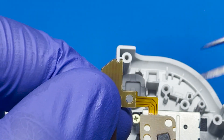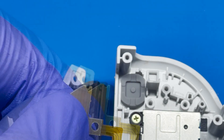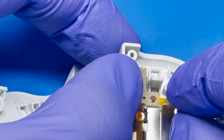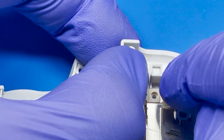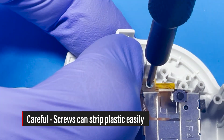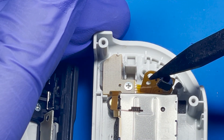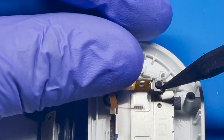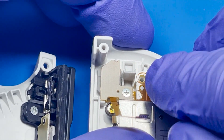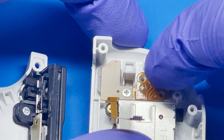One of the easiest ways to put this back is by aligning this little notch located right here and pressing it up against this piece of plastic right here. When you place it right up against it, this should line everything up and make it a lot easier. You can see that the hole is lined up properly, so we can just get the screw and put this back to hold everything in place. Once you have this screw in place, bend this back and make sure that these two holes align as well as that third one down here. The goal is to align everything together — you can see the three holes are lined up. Once you have those lined up, just screw everything back together and you should be good.